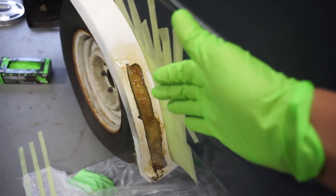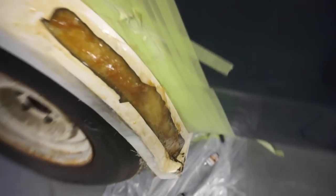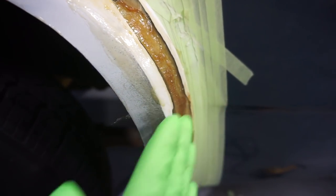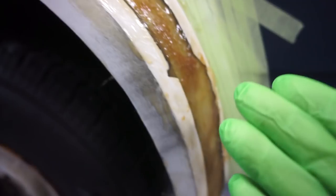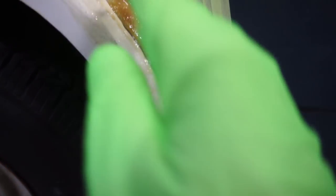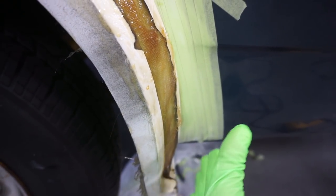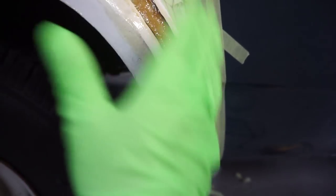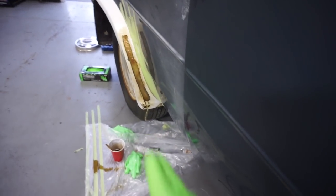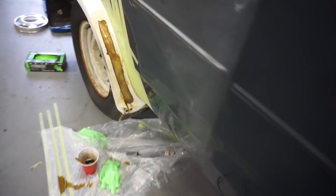All right guys, so there you have it — I just finished putting fiberglass and fiberglass resin in the big open hole we had there. The reason why the hole got bigger is because this edge was actually facing this way while our groove was going this way, so I ended up grabbing the sanding disc and tried to level as much as I could. I just made the hole a lot bigger, but it's no big deal — put fiberglass there, and once it dries tomorrow I'm gonna add more layers. Once it's about even, I'll start sanding down and then using body filler mixed with fiberglass hairs in it. We'll sand it and then put primer on it and you won't even be able to tell the difference. Then we'll make this shape happen again, flatten this out and it'll be like nothing ever happened.